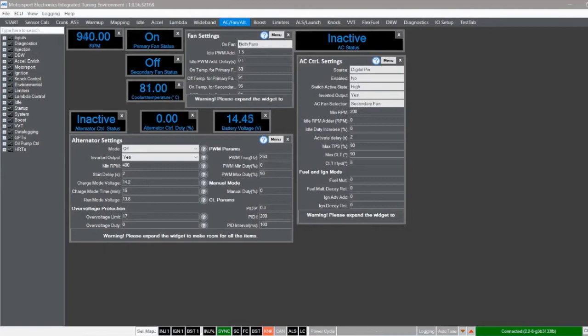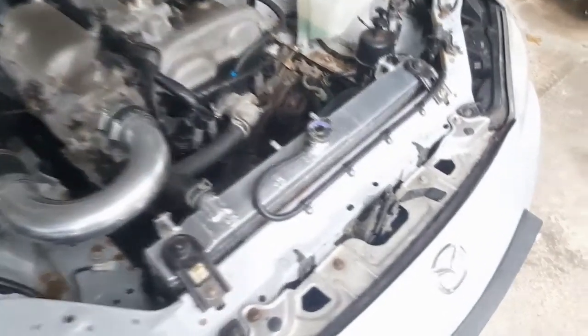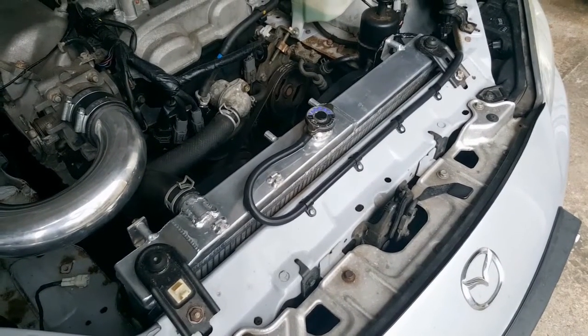The fans are working fine, so now I'm back in Mighty and I'm just going to change this on-temp for the primary fans back to 93, click enter - job done. So there we go, that's another episode in the books and another step towards supercharging this car. This episode was more preventative maintenance than anything else, but after doing this mod I do feel a lot better about this cooling system's ability to deal with the extra heat generated by a supercharged engine.